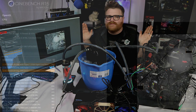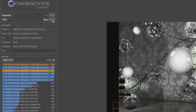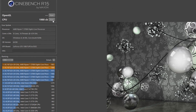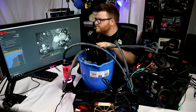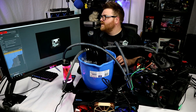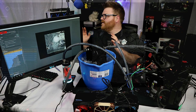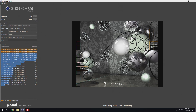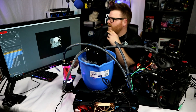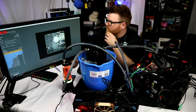We're at a ridiculous voltage — 1.475 or something stupid. I'm not putting the voltage any higher; I know something's going to go wrong if I do. 1980. I'll let it settle for a second, and I'll do it again. 4.39 gigahertz. Come on, give me that. I would settle for 1990 at this point. 1978. With how stable this is right now, I would imagine I could bump the base clock up a little — the core clock control.